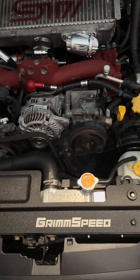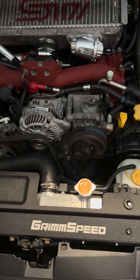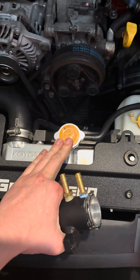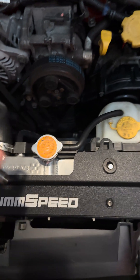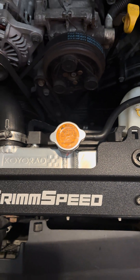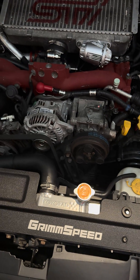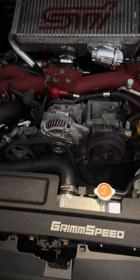So, if you are going to bleed the system in your Subaru and you deleted this cap, what I did is I just jacked up the front end, made this cap the highest point. I put one of them coolant feed flow bubble thingies on there. That was it. Never had a problem with my coolant temps since. And I did this weeks ago.